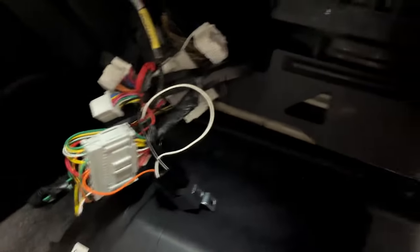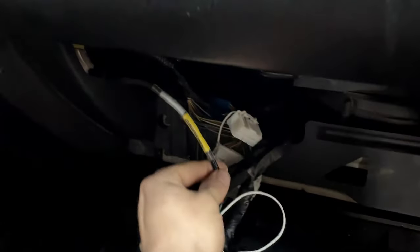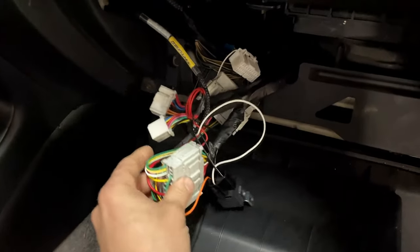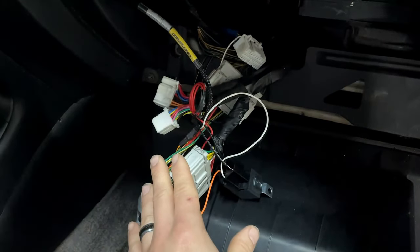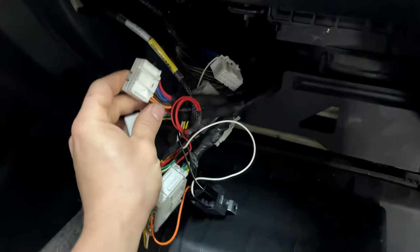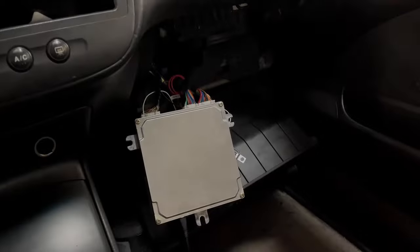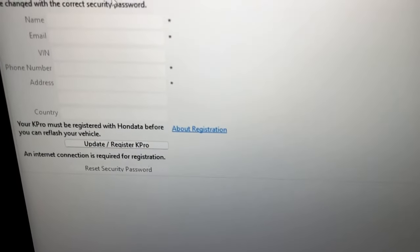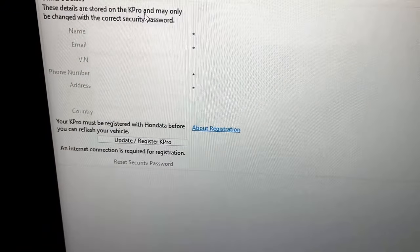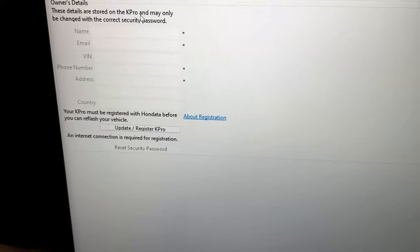As you can see here, we've got everything ready to go. We already ran the primary O2 sensor wiring out. We have everything hooked up from the C101 connector to constant 12 volt and stuff like that, everything's good to go. We're just going to go ahead and plug the ECU in. We got the ECU hooked up and the USB running to K-Manager. Now it wants us to register K-Pro, so we're going to go ahead and set all that stuff up and then we can upload the tune into the ECU.